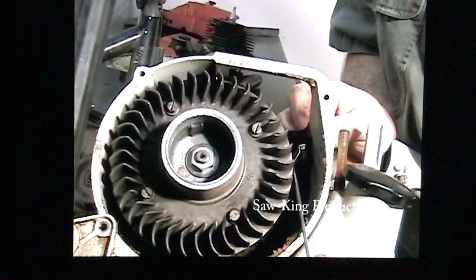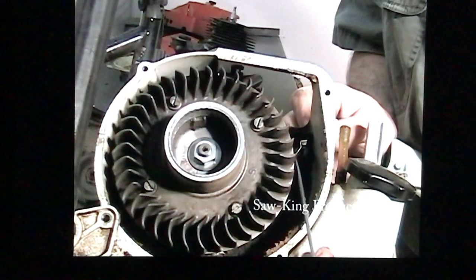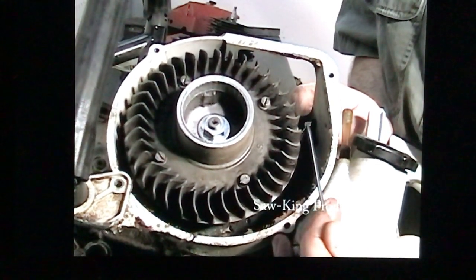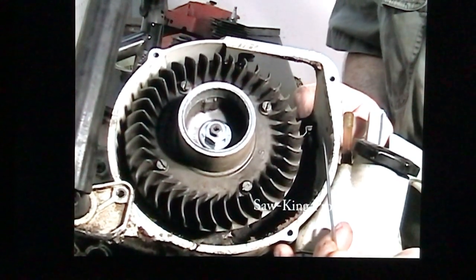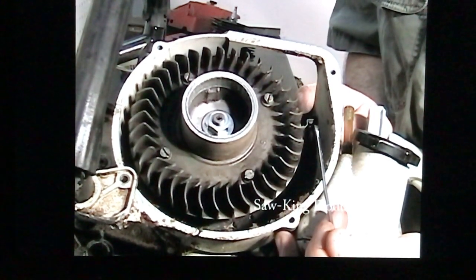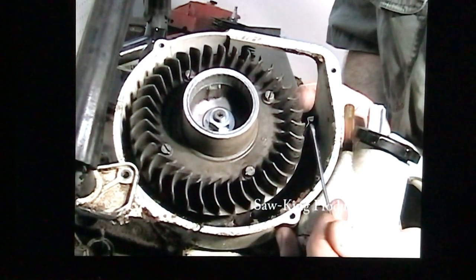And when the saw reached a certain RPM, it pushed up against this and actually closed the choke, slowing the saw down. It's real common for timber cutters to take and bend this back, wrap it around here, or just cut it off and run it without the governor. You could do this, but you had to be very careful. This saw, if it reached certain RPMs, had a tendency to scatter and was very dangerous for the motor and probably the operator. But that's your air vane governor. That keeps the saw within the specified RPM ratings from the factory.